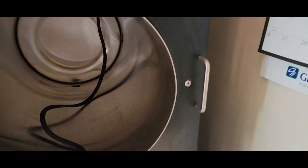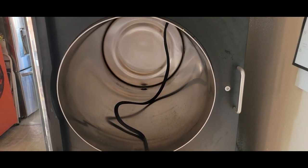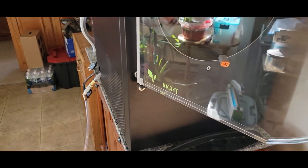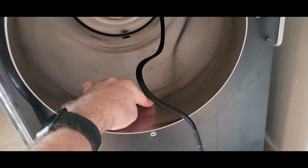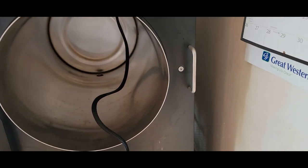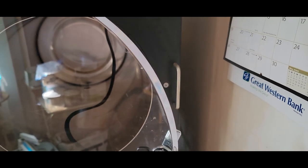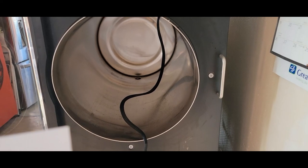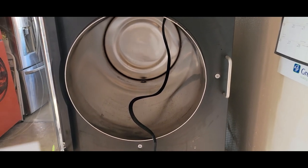It's all wiped down — clean and dry. The drain valve is open because it's been draining. The directions say to make sure the drain hose is sloped down and that water is out, and it is — it's always been sloped down. There can be a little bit of water collecting in that small ridge, but the drying cycle does dry it up. I leave the door open slightly between batches. Next step: remove the vacuum hose and check the o-rings on both ends to ensure they're not damaged.